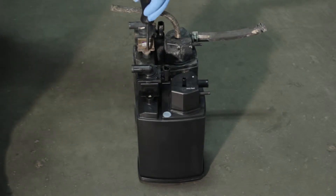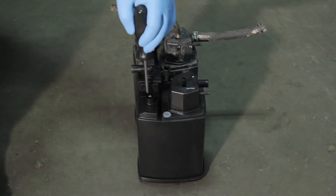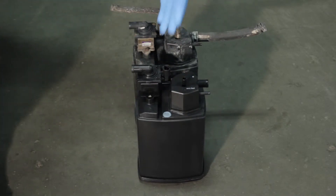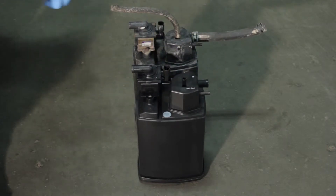There's quite a bit of rust on this old canister, so we're going to have to do a little bit of fighting to get these bolts out. Otherwise we can just go ahead and replace them with two new four-millimeter bolts. We'll transfer our hoses over and we'll be ready to install our new canister and vent solenoid.